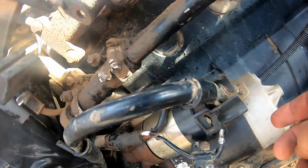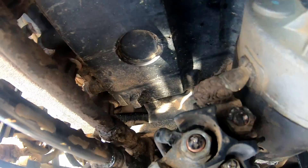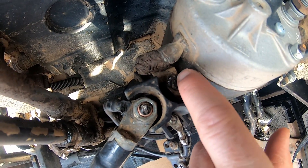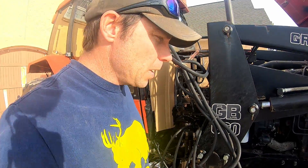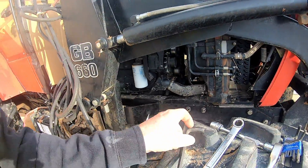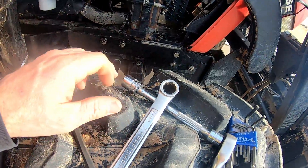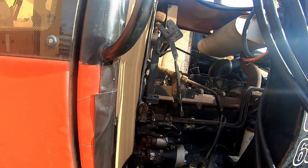There's also a terminal that can get melted on the inside. Let's go ahead and swap the starter out — it's pretty easy. You need a straight screwdriver, an 8mm metric allen, a 17mm wrench, and a 17mm socket. If you have these you can swap out these starters pretty quick.